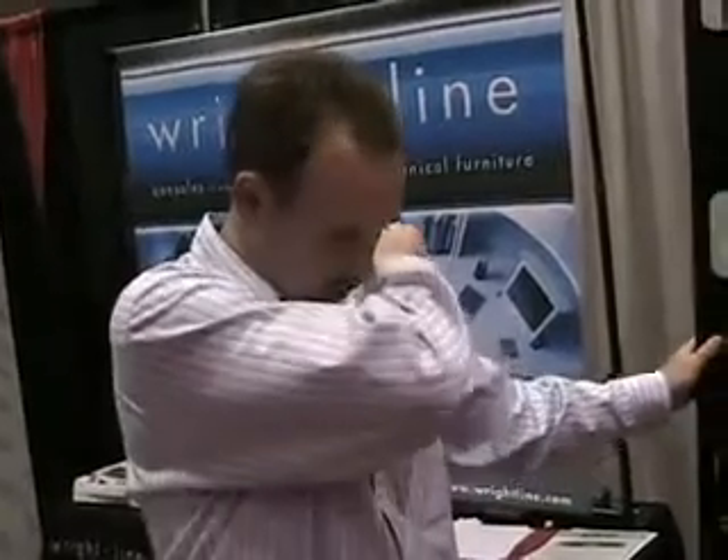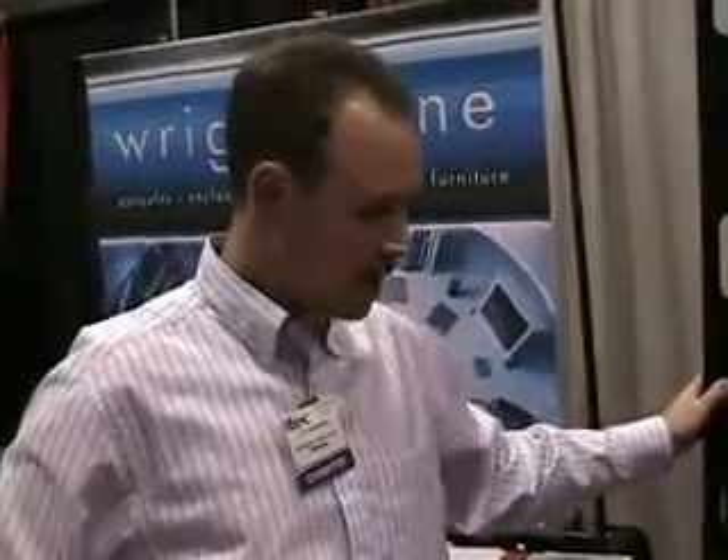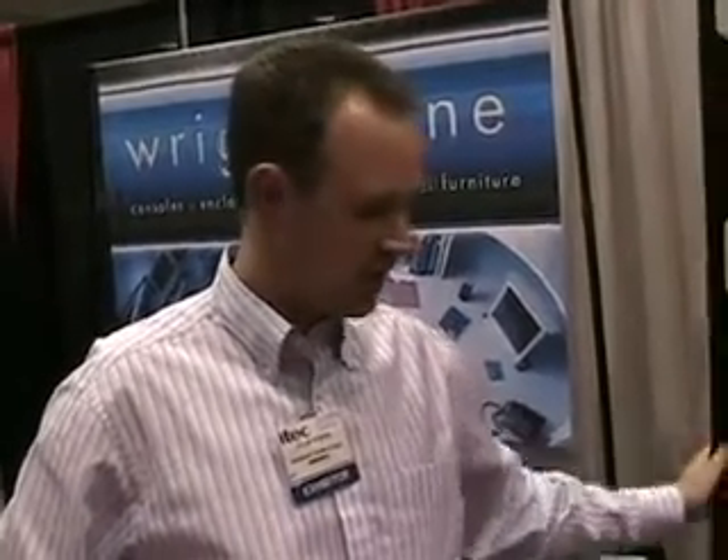You can put anything on here, but I assume people put things that are more prone to earthquake damage? The requirements are vibration sensitive and mission critical — not so much UPS, but more servers, SANs, tape libraries, anything vibration sensitive. Hard disks are certainly vibration sensitive. Absolutely. We have hard disk arrays that go through earthquake events and come out without a problem.